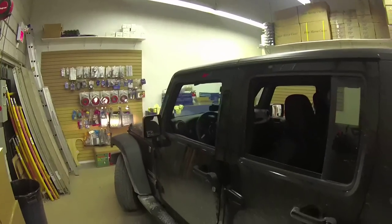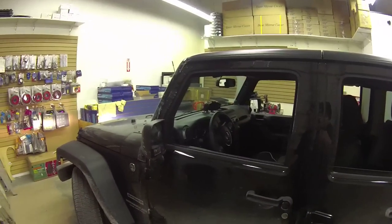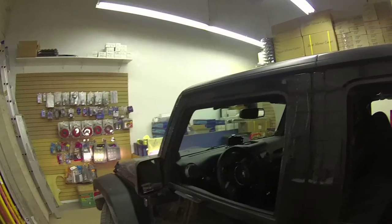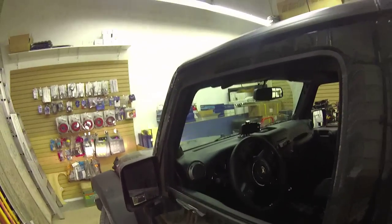Same thing would happen if I jacked this vehicle up — that's what the digital tilt sensor does. The digital tilt sensor detects if the vehicle is being towed or if somebody is trying to steal the wheels. In the springtime the customer is planning on adding aftermarket wheels, so it was important to him that he could protect those. And then with the double guard shock sensor that the system comes with, if you impact the vehicle it will trigger the alarm as well.